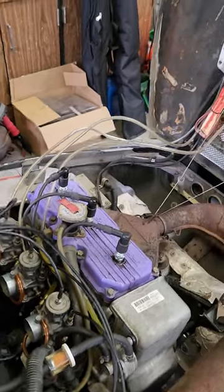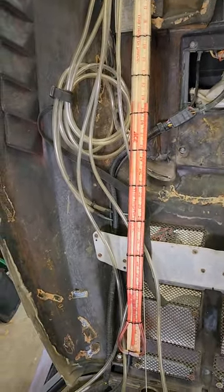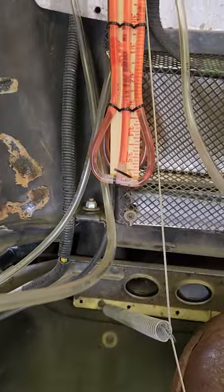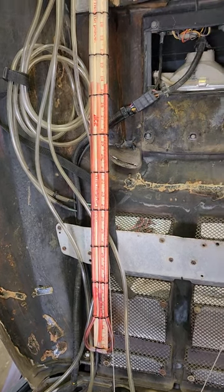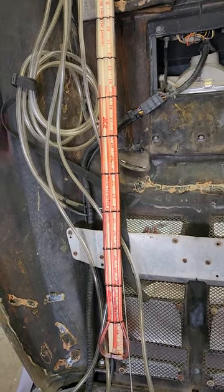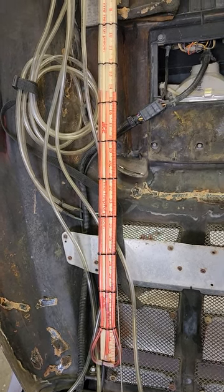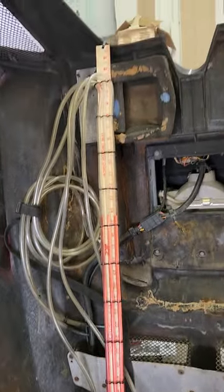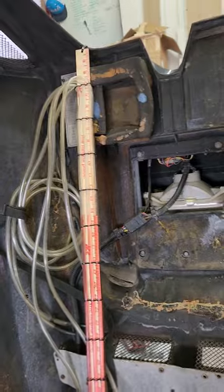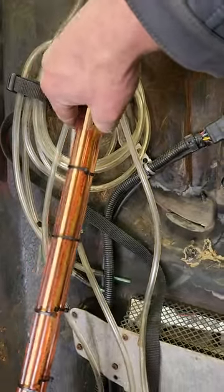What I'm using is a manometer. Went to Ace Hardware, got a yardstick, Tygon tubing, and a T-fitting. There are three legs: the right-hand leg is going to the mag side cylinder, the center leg is going to the center cylinder, and the left-hand leg is going to the PTO cylinder.